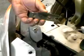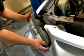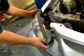After the shielding is removed, you will notice 2 safety pins located right above the headlights, as we have indicated here in the video. We can remove the locking clips by pulling the inner ones out and then pulling the outer ones slightly up. We can then gently pull the headlights slightly out to expose the back of the headlights.